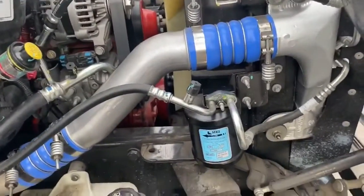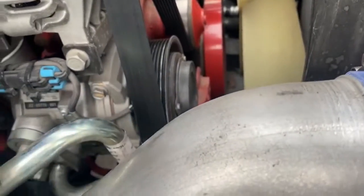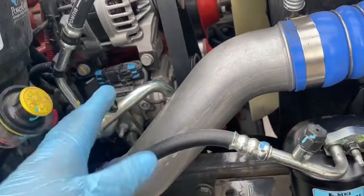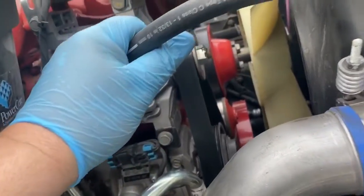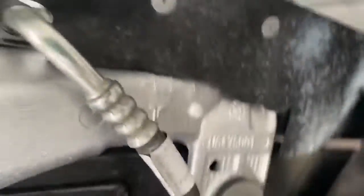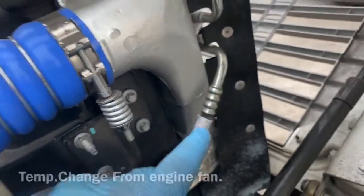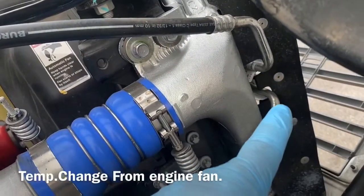So when you're starting your truck and you're running the AC, the compressor clutch engages right there — click — and it starts pumping high-pressure Freon through here. So right here at the line, when you touch this, it's going to be really hot. That's a good sign. So really hot coming out, goes through here, goes down, goes inside your condenser over here, comes through there. And going from here to there, there would be a temperature change — this one here, it's not going to be extremely hot but you can feel the difference in temperature.